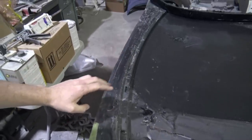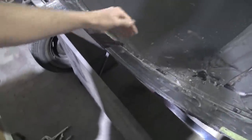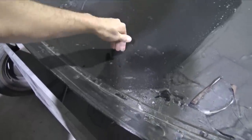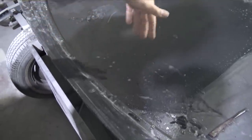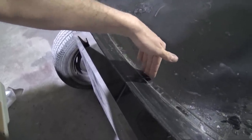He recommended me making a break. So what a break is pretty much you don't want the resin to come up and then start filling the vacuum line. Even if you have a catch pot to catch the extra resin from getting into your pump, because then it's not really pulling any more vacuum on the part. So what you do with a break is you pretty much have the bleeder fabric. So you have the carbon fiber fabric, the peel ply, then you have a layer of bleeder, and then you don't. So what I'm gonna do is pretty much end the bleeder right here.